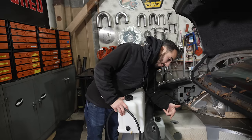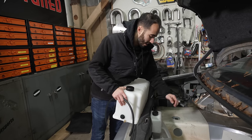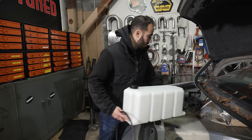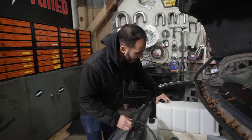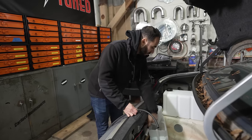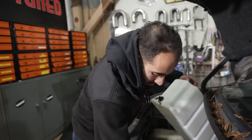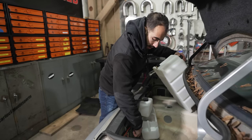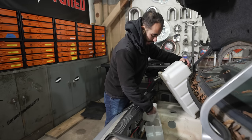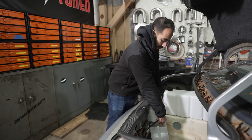So we have a Holley meth setup in this thing. It's a very, very serious pump, but it has a little tiny tank. And when we were on the dyno the last time, we were filling this thing every 4 seconds. So the guys at Holley sent us over this gigantic 5 gallon AEM tank, which is gonna fit just perfectly right there. So I'm just gonna pull these lines off real quick. This was actually tapped for 1/8 NPT and had a push connect fitting that uses this line. Everything else we have here is the larger diameter silicone line, including the filter that's in here. So I'm just gonna pull this off the bottom of this tank, get it out of the way, and then just run a little bit of extra line. Mount this tank over here, connect it up, and we good to go.